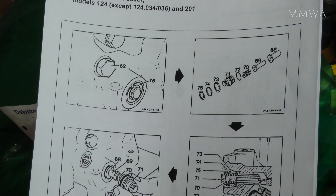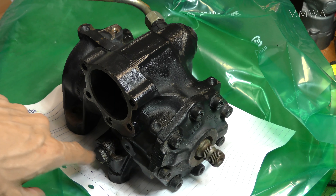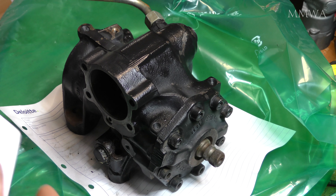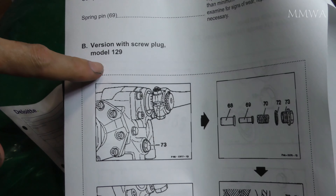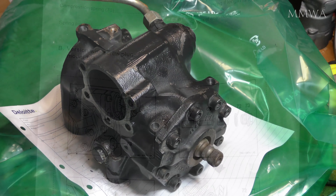This play compensator does not have this kind of cap on the right-hand drive car, on this 1990 version anyway. It has the screw plug as per the 129 that is mentioned here. Obviously that's a picture of a left-hand drive box, which makes it pretty clear that this is the wrong manual for this car, but it still works with some differences.